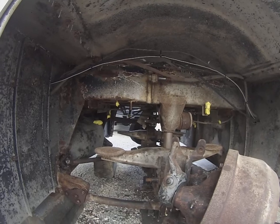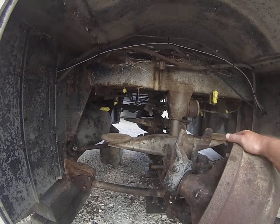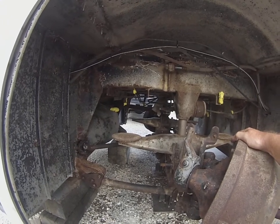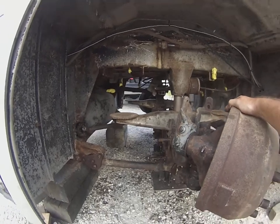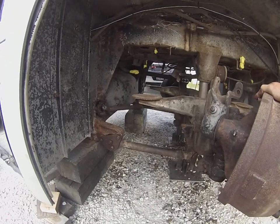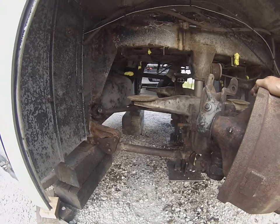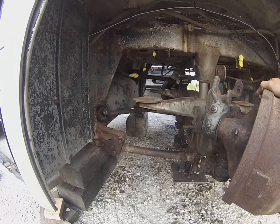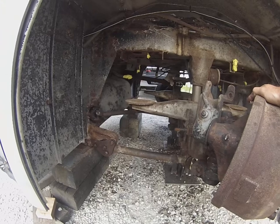The other thing is, when you're pushing the bolts out, you can kind of tell if there's a ton of tension on those bolts. That means something's trying to move, so you might want to reevaluate. It is difficult to tell if bolt resistance is due to corrosion or if they're getting pulled on. So if your bolts are all rusty and you're having to hammer out all of them, it's going to be kind of hard to tell.